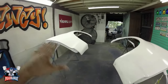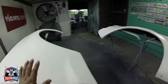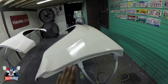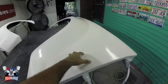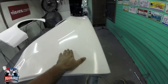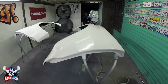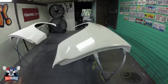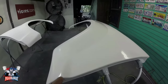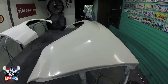I've got both sides of the beds. These are fiberglass. What you're going to have to do is sand it — you're going to have to sand this white primer. Do not — I repeat, do not — want to apply paint on top of this primer. This is a primer gel coating type of material that they apply and it's no good for paint. You need to sand it down and prep it. I'm going to start sanding it with 220 — this panel is nice and smooth, so let's start sanding with 220.